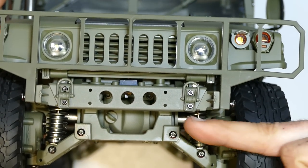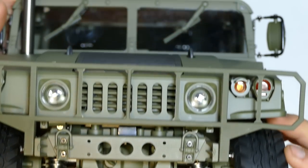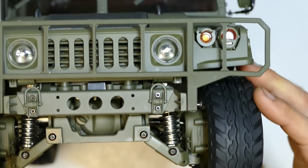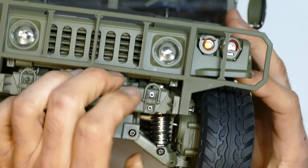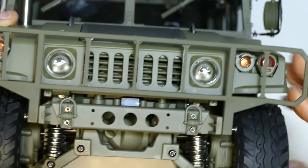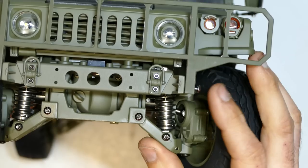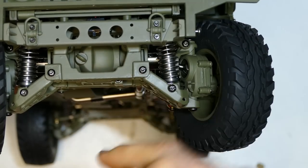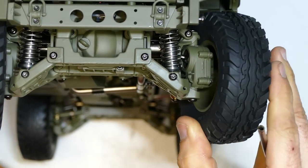Right here you can see the portal axles. Your drive's coming in and then it's got a reducer — or portal axle — down below, driving out the drive wheel. So the input is up there and the output is at the wheel hub — portal axles, awesome stuff. The shocks are metal and you can probably adjust the preload with some clips inside. I'll leave it and see how it performs. Using a magnet to check — definitely metal frame, C-channel, mixed plastic and metal throughout.